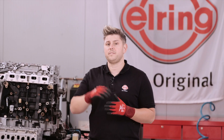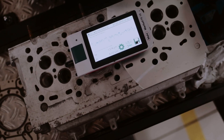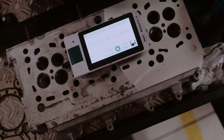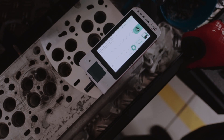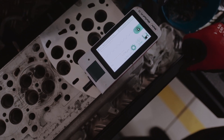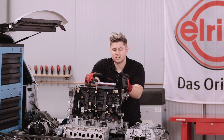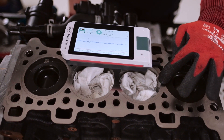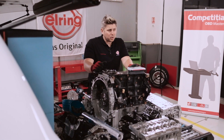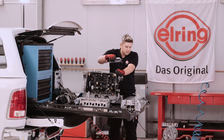The next step is we have to check the roughness of the surfaces — block and head. If you test with your roughness tester, the surface will give you a result like this. This is a used surface, but a surface which our gasket can work with and it has the right topography. This should be what you get back from your engine rebuilder shop. We put our roughness tester on the surface and check the roughness. The roughness is totally in range, but more important is the topography — the topography is what allows our gasket to work properly. Let's check this also on the cylinder head.